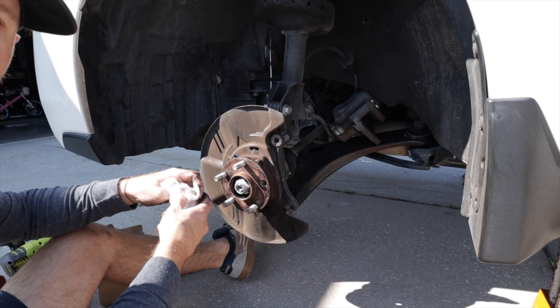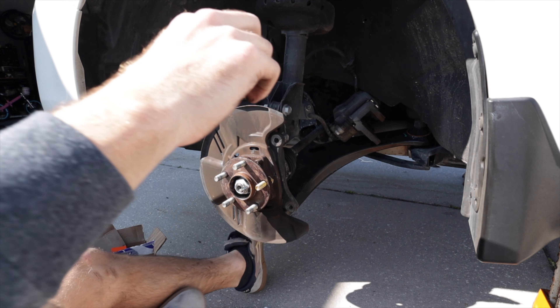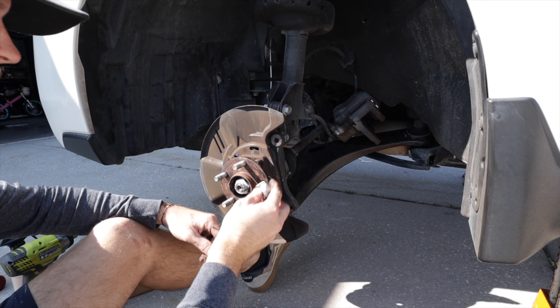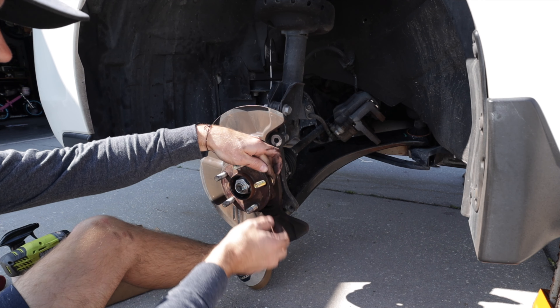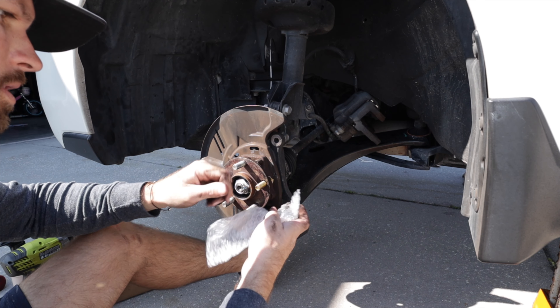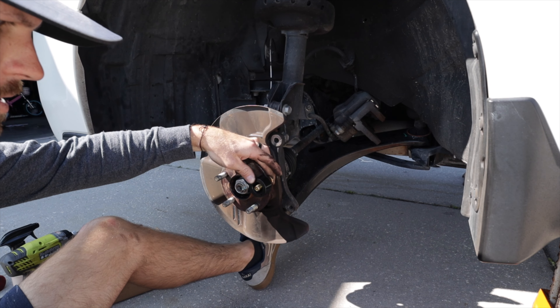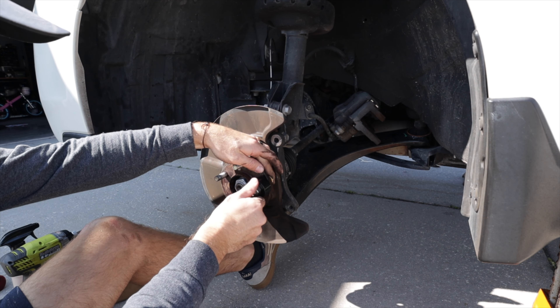She's out! Now how do we put the new one in? Slide it in there. Here's one of the good ones — I also bought new black lug nuts for when I put the new wheels on. You can't just thread a lug nut straight on because it won't go deep enough. You can either use a big nut to create space, or buy a wheel stud installer — which I recommend. Everything I'm using will be linked below. This goes right over it and all you need to do is put the nut on and crank it down.